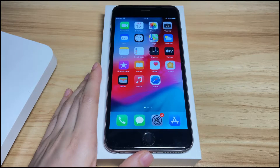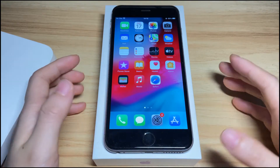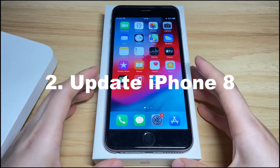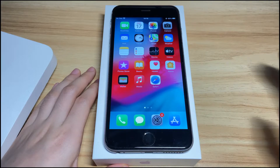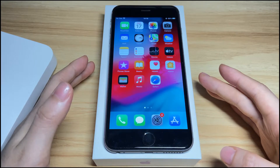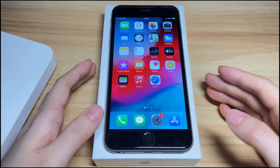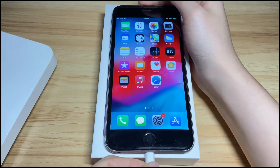What if your iPhone 8 is frozen and won't turn off or restart again after the forced shutdown? A software update needs to be done right now. Instead of doing that directly on your frozen iPhone 8, there's another workable way, which is to update via recovery mode. First, open iTunes and make sure it's running the latest version. You'll need to open Finder if you're using a Mac with macOS Catalina 10.15 or later. Then grab a USB cable to connect your iPhone 8 to the computer.